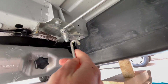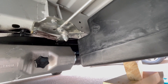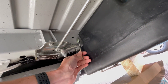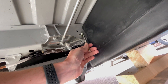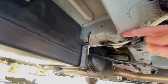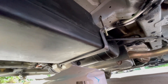The issue this side is the handbrake mechanism. I've marked with an X where I think I could drill, and the hook will be able to hang at an angle so it will hook through and kind of hang at an angle missing the handbrake mechanism. I'll try it — if it looks dodgy I can try a different approach. So, back under the van: I've dry-fitted the tank now. I drilled holes here for the hook to fit into, and the other side with the handbrake was actually okay.